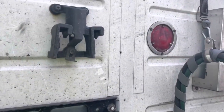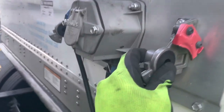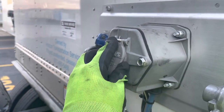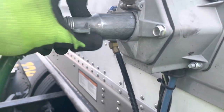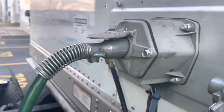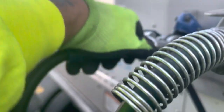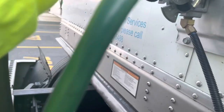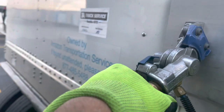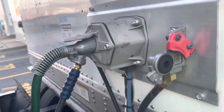Normally the lines would be on that black pouch which holds the lines in the back of the trailer — that's the proper attachment for them. I had unhooked them beforehand because I'm holding the phone in my hand. They get attached to the sockets on the trailer: the gray one is the electrical that controls the lights on the trailer. The blue airline goes on the blue socket, and the red one goes on the red socket. Once both are properly attached, the trailer is properly attached to the semi, the brake lines are connected, and you can safely operate the vehicle.